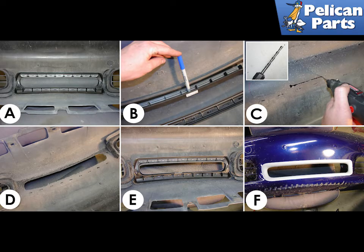If you wish to save some money, you can drill out the opening for the front radiator yourself and reuse your old bumper cover. Line up the retaining piece with the inside of your front bumper cover. It should be centered between the left and right openings and fit flush against the curve at the bottom of the cover. Use a marker to trace the outline of the opening and the slots for the retainer. Carefully, using a Dremel tool and a milling bit, cut your cover. It's okay if you're not 100% accurate as there is a front trim piece that fits over the opening and frames it. This shows the opening cut out along with all of the small slits needed for the retaining piece. Test fit the outer trim piece and the inside retainer to make sure that they fit together well. Here is the final assembly and what it will look like before it's painted.